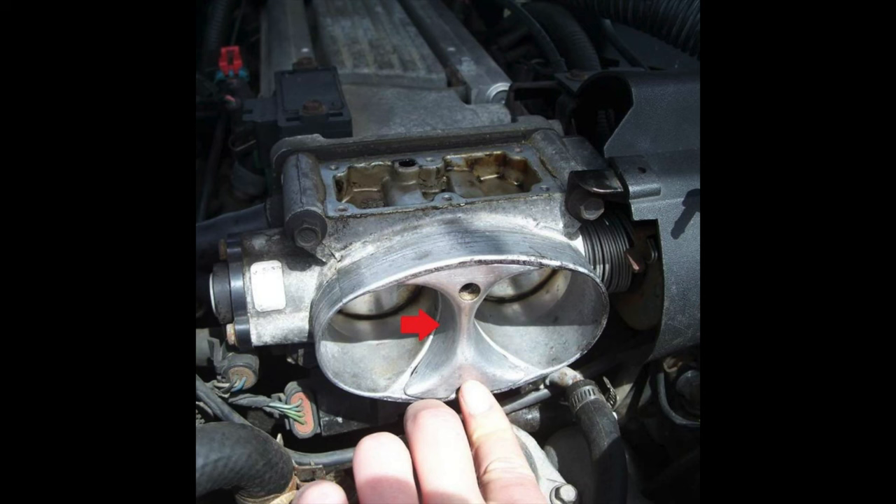I would always try to keep the car between 175 and 185 degrees — that seemed to be where it worked best. Anytime it crept up to 195 or more, it would really slow the car down a lot. That's why to me these are must-have modifications and they're cheap. Another cheap mod that doesn't add much power but is inexpensive is the throttle body airfoil — I would definitely recommend one of them.